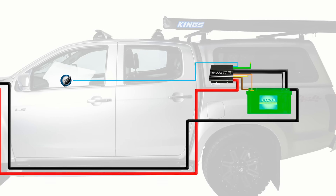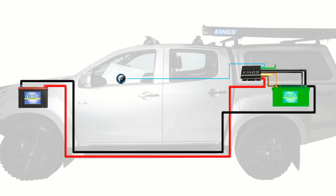For the same reason they're perfectly suited to a temperature compensating or smart alternator. Not only will it boost the voltage up as required, but particular models have an ignition sense wire that, when connected to an ignition source, tells the DC-DC charger to start charging. That means even with the smart alternator turned off and not charging, the DC-DC charger will continue so long as your vehicle is on. That in turn will drain your starter battery over time and cause the alternator to turn back on, meaning you're still able to save fuel without over draining your auxiliary battery.